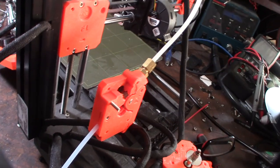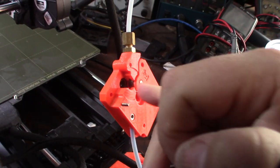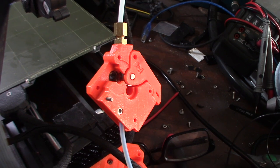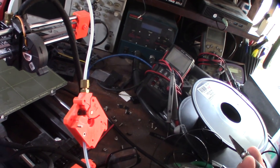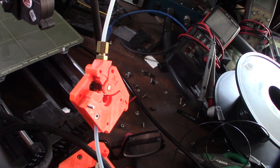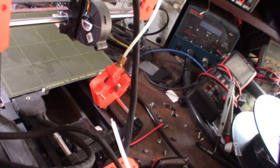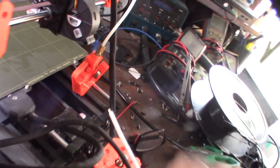There is a little piece stuck in there! So there's another blockage — I can't even get the filament into the hob gear spot. It's more complicated than it needs to be. Troubleshooting like this I can figure out, but the average person can't. Since you can't see the path you're working blind — you'd never know it was all jammed up if you didn't take it apart. There were multiple jams. I can see a piece of clear filament stuck in the PTFE tube.